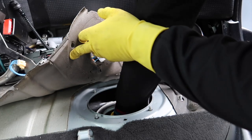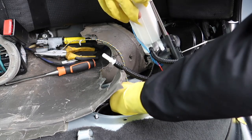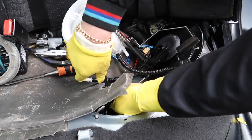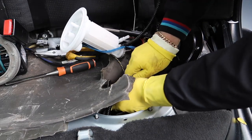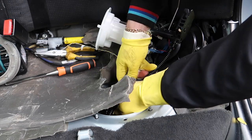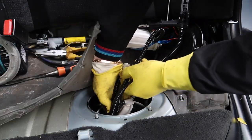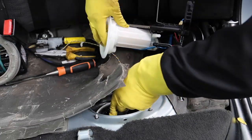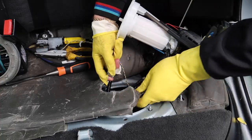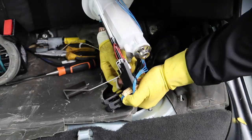You're going to want to lift these up and then reconnect them all to the filter. Very simply — make sure you don't mix them up. You'll have this one which goes right here onto there, then you'll have this one that goes right onto there, and then this one which comes off the fuel pump goes here as well. Be careful not to mix them all up, and be careful not to break the float either.